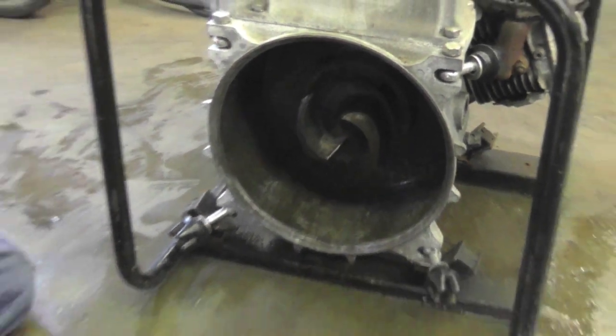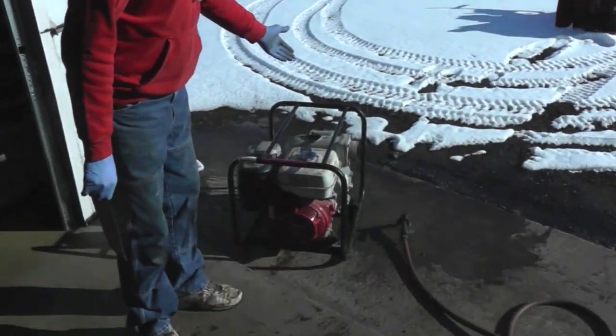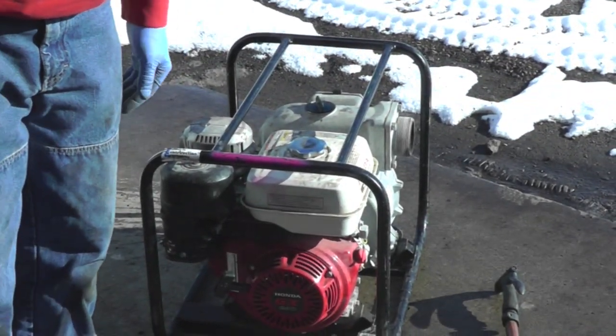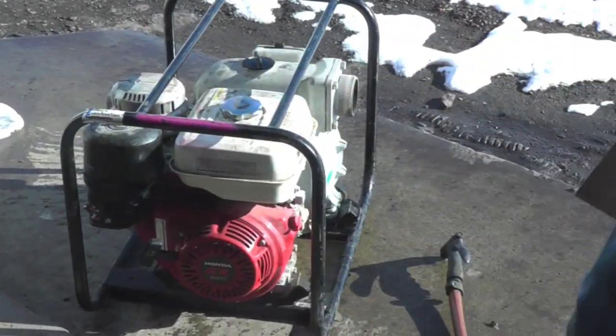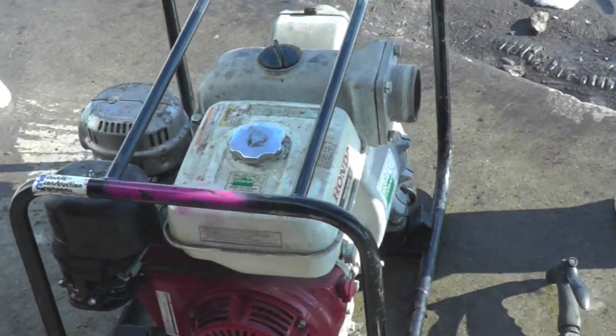Put the cover on. We're going to check it. And if the clearance is good, we're going to fill it with water and see if it pumps. We've got the water pump all back together, everything on. Now you've got to fill it with water — that's what lubricates that seal behind that impeller. So I'm going to start it up and show you.